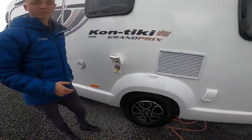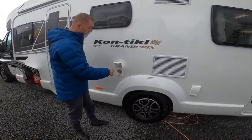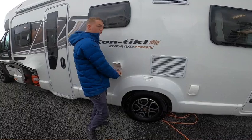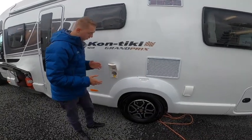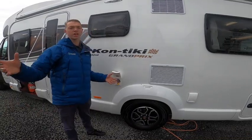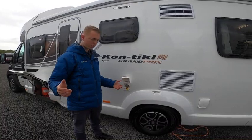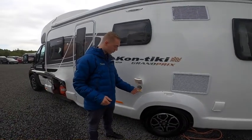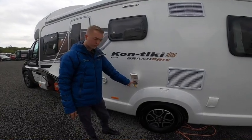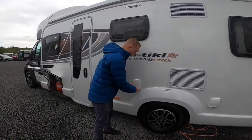And you've also got an external gas point. So should you be wanting to use a gas barbecue, you can connect here and it'll use the bottles on board the vehicle instead of carrying an additional bottle inside the van. All you'll need is a quick release connector, a length of gas rubber orange hose, and two Jubilee clips to connect both ends to the barbecue and the quick release connector. And then you turn your grey tap on and that'll allow the gas through to your barbecue or awning